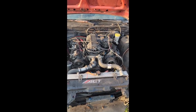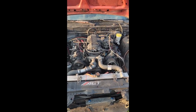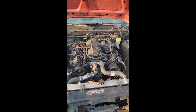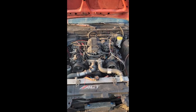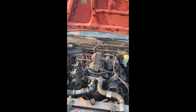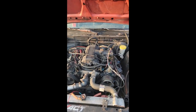Not sure what changed but it's not making that racket this time at all — maybe it was just sitting for a while and things needed to get oiled and broken loose, lifters pressurized, whatever. She's running fine. Aside from making some kind of high-pitched keen — which could be a vacuum leak or any number of things — it's running really well. That high-pitched noise is awful. Obviously it's running a little lean or rich and smoking a bit. We already knew that — I talked with the previous owner and apparently there's some issue with the wideband sensor, which is why the airflow readings are all over the place, which could lead to an engine running in this manner.